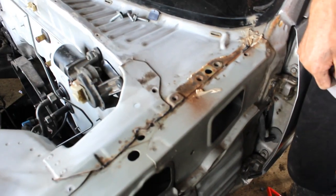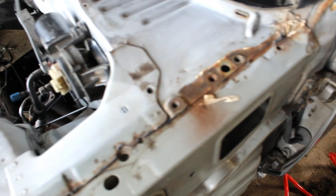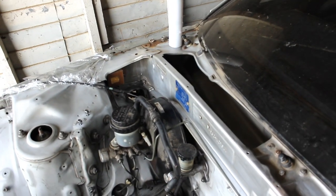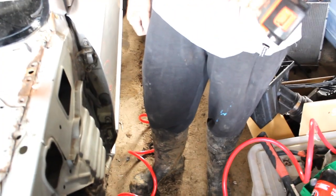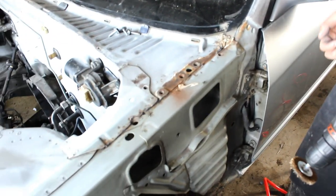After sanding we've found a few spots of rust — there's a bit there, a little bit in the middle as well, and a bit on the other side too. So we're just going to treat that before we paint. We're going to treat it with this product here. First we're going to wire brush it down a bit and then treat it.